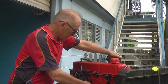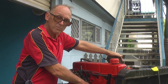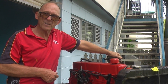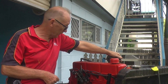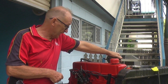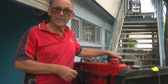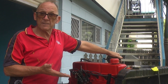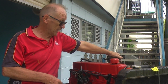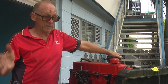There's also vacuum advance. We can take the vacuum hose off, and I've got a vacuum pump that I can use to pump up the vacuum unit, and we'll see how much extra degrees we get on the vacuum advance — see if that's within the original specs. From memory, if we can get 10 or 11 degrees at 2,000, starting at 11 and hopefully around about 28 to 30 degrees at 3 to 3.5 thousand, that's a good starting point for this engine.